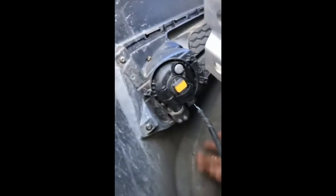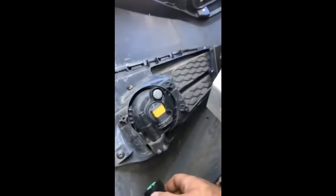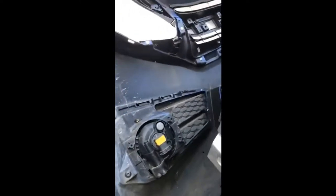You also need to unhook your fog lights. You might have a little trouble up here where the grill part gets stuck. I recommend putting something under the bumper to hold it up so it won't scratch. Sneak in behind the fog light connectors and unhook them — you may have to lift the bumper back against the car to get your hand in. The fog light connector is pretty straightforward: push the little tab in and pull down.